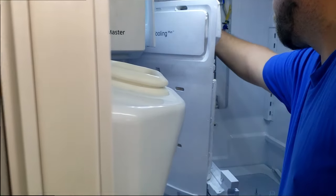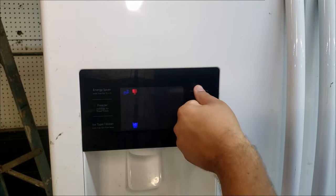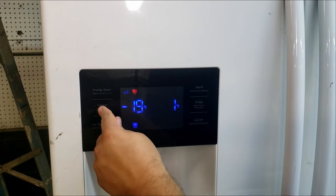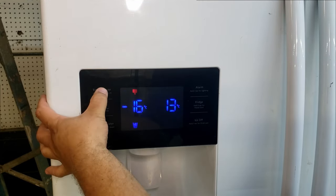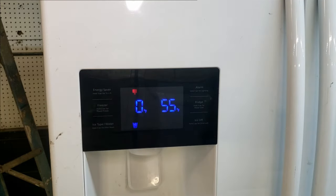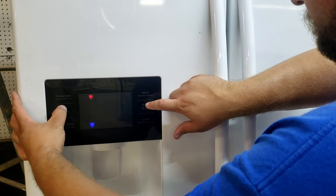In the process of running and checking the defrost heater, the control panel cycled back to the regular options on the panel while continuing to beep. The beeps meant that I could select options on the panel such as temperature settings, but the defrost heater was still running in the refrigerator cabinet and the noise was a warning. Obviously this needs to be turned off at some point, and the only way to get back into the forced mode was to re-enter the same code again and then go through and deactivate it entirely by pressing and holding the buttons to get back to the forced mode.